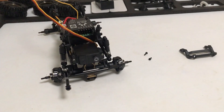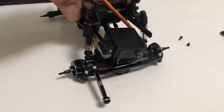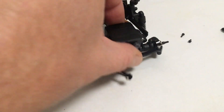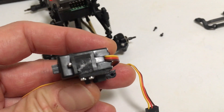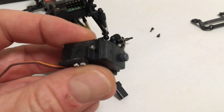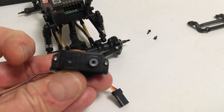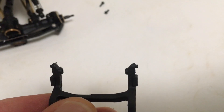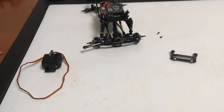I did end up having to do the typical Dremel work to the mount and servo ears to get it to fit between the frame rails. You've got to take off the top and get the sides as narrow to the screw as you can without compromising the mount — chamfer that top edge a little bit. The C10 bumper mount needed the same treatment. Now with everything trimmed up, it should fit.